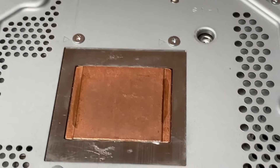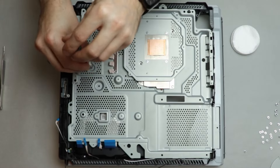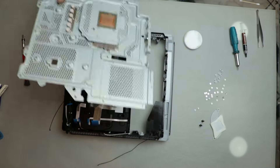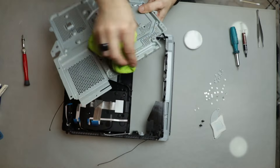Before I install the new thermal paste, I still have to reach the fan and the radiator to clean them as well, and so I have to remove those two screws and take out the second metallic shield. I will place those screws grouped with the fan once I take it out to keep track. I use the wet towel on the plate.